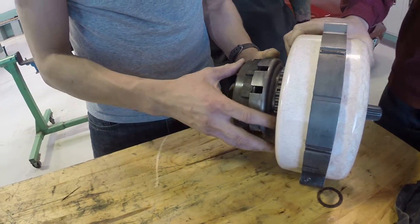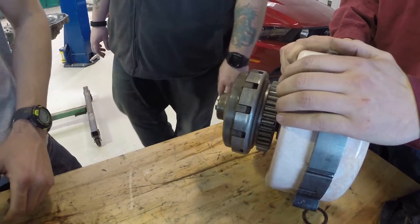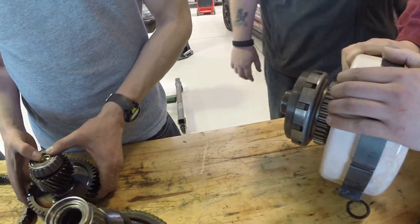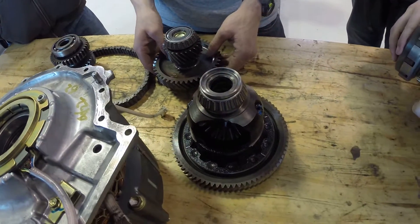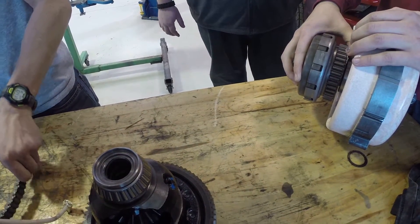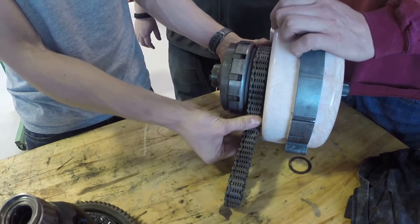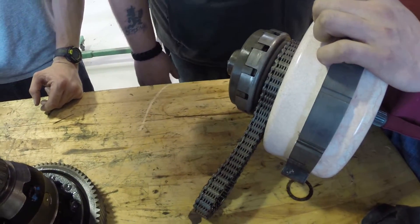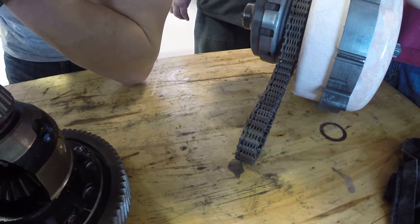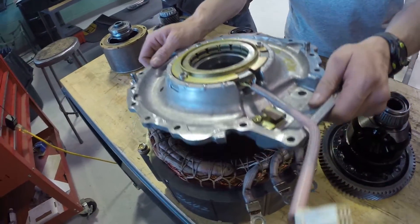Okay, what's going to go over here on this side? Take all those final drive gears and just put them off to the side. Take your chain — your chain is going to go on here, but the other gears we don't need to line all those up. We'll put the chain there so we remember that's where the chain goes. Notice how that chain is kind of stiff? There's a little spring in here to provide interference between all those links, just to keep it tensioned. Take that cover and move it off to the side because we don't need that right now.